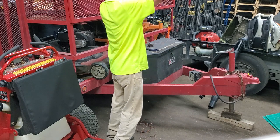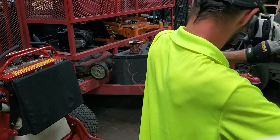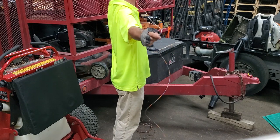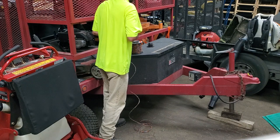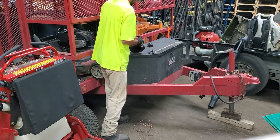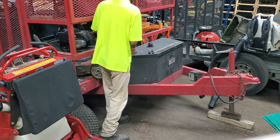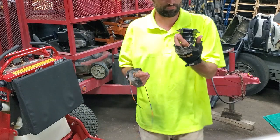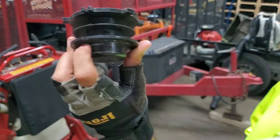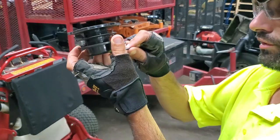It's like 85 degrees outside in the warehouse and this string is all curled up. This is a durable CF-3 pro string, 095 — two sides of string, both about 15 feet. Now, there's basically a wind line indicator on these bumper heads, and inside there are little notches. You look at the wind line, look at the holes, and you want to start with the one towards the bottom of the bumper head first.